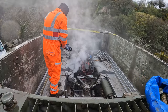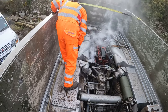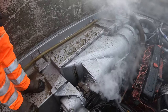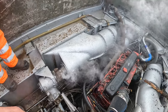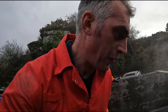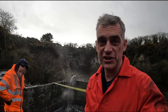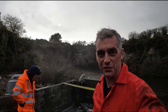As you can see, we had a slight issue — smoke coming from one of the thruster drive units, so we decided to call it a day and come back in fairly hastily. I think either a bearing or a seal isn't very happy in there. At least it did get us back in and we didn't sink. A little bit of water did come in and we have several leaks to fix, but it wasn't even enough to kick in the bilge pump — not enough water to actually reach it. I would still say that's quite a successful first test run.